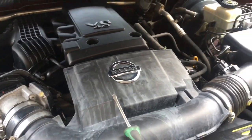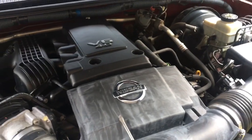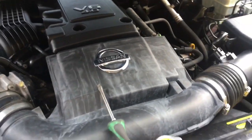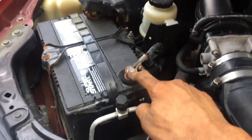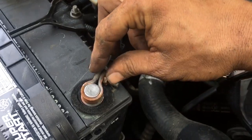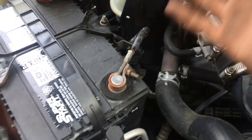Remember, you can't break what's already broken, and this is one example of a shade tree mechanic type way to fix something, but it's actually a pretty darn good fix. Have you ever had a loose battery cable on a car like this, where somebody has over-tightened it? You don't have to really tighten these up a ton — you're supposed to have a pretty good gap in between there, but they've over-tightened it so much that they've stretched the metal around here.